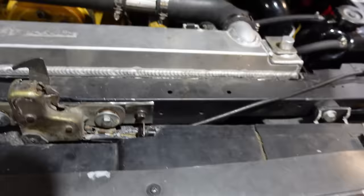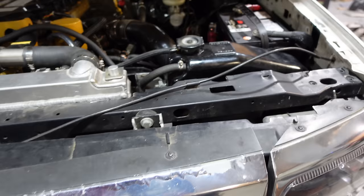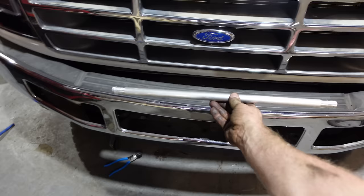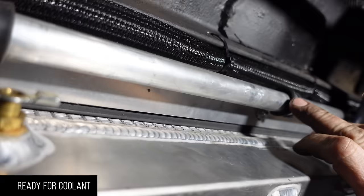I think the bleeding stopped so we can go back to work. I did move my overflow tank to go on the bottom right radiator hose rather than the top, so put that back on. My three-quarter-inch hose isn't long enough now since it needs to go over to the other side, and there's none in town. I got a piece of aluminum with some barbs on the end — that gets mounted on the bottom of the radiator and I have enough hose to go from one to the other. Pop that on, throw some coolant in it — another big step done.